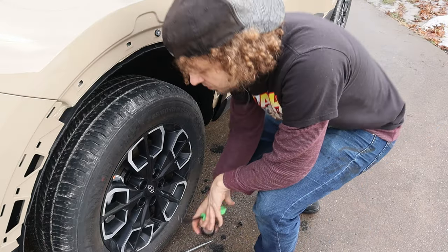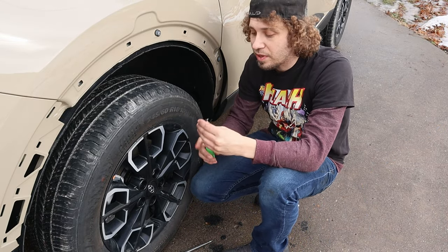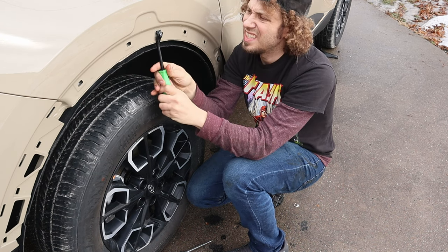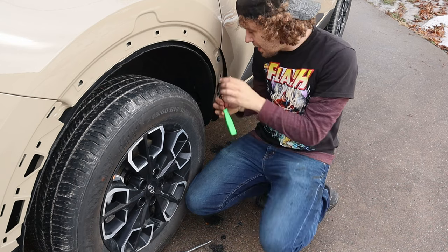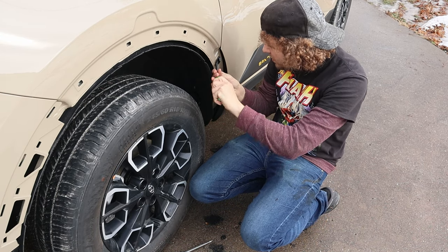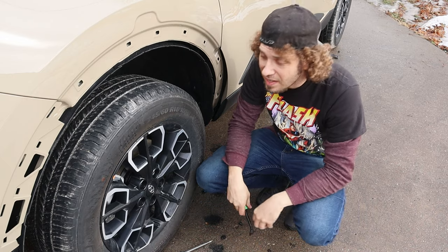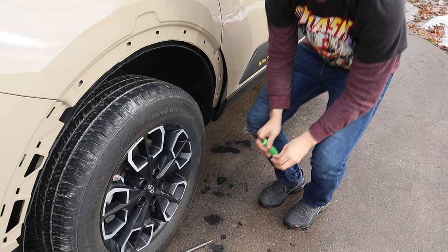All right. So unfortunately, a couple of the clips did stay in the panel. So I just grabbed the body removing tool. We're gonna try to get this guy out. Actually, that's the way to do it. Twist it out. Guinea pig. Twist that one out too. So turning the clips actually releases them intact if you did want to save these. So that's kind of nice. But make sure we get all those clips removed.